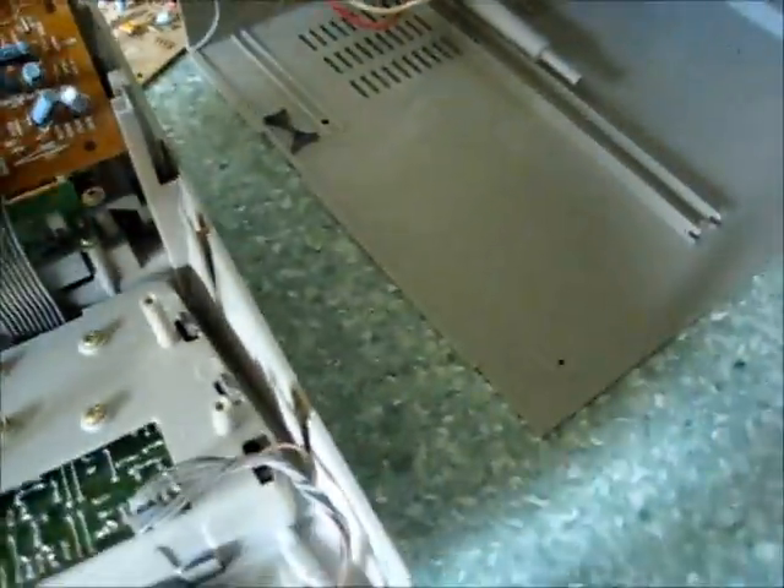There's our control board. This is a neat little vacuum fluorescent display which has somehow been burnt in the corner — I don't know if that's just a manufacturing defect. It's technically a little picture tube, known as a vacuum fluorescent display. You can see closely the little shadow mask in there and the phosphors. It looks almost as if it's built like a picture tube of a CRT — it's got the same characteristics, with what looks like guns and little bits across the middle. Now all those screws are going to come undone to get to that front control panel. I think that's the date — 14th of 1999. So not very old.